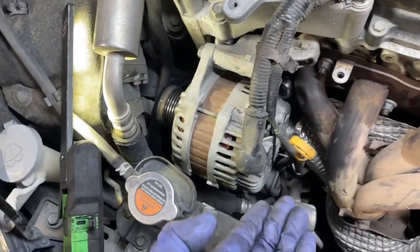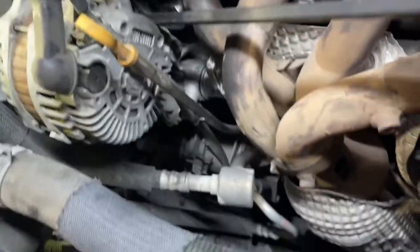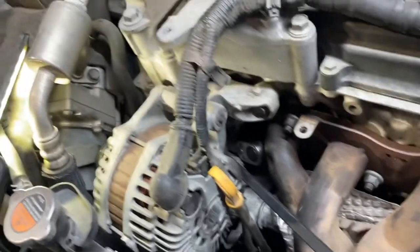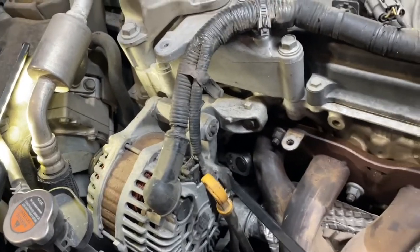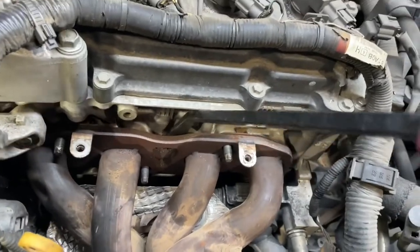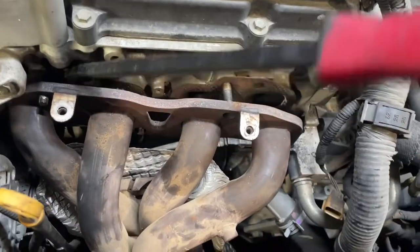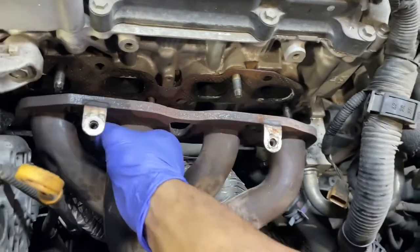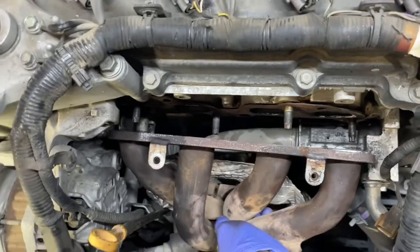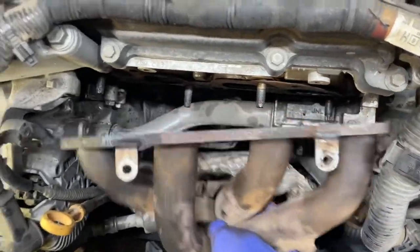So we can just swing the alternator up a little bit to give us clearance. I'll use a pry bar on the ear right here on that bolt and just kind of bring it up. We can even tighten the bolt to hold it in place. Now we have room to get to that nut. With all my nuts removed, I'm just going to go forward on this exhaust manifold, bring it forward all the way, then lift it up off the downpipe - it should come straight out with a little maneuvering.